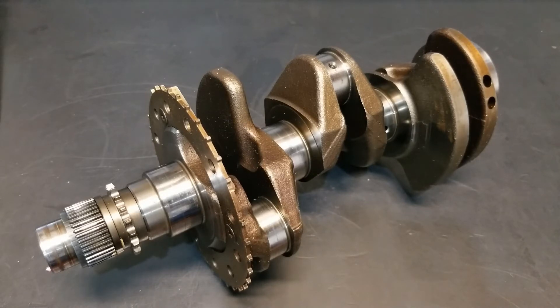This journal that we'll be measuring today is a main bearing journal on a crankshaft from a 2019 Mitsubishi Mirage 1.2L 3-cylinder engine. In order to find journal taper, out of round, minimum wear, and maximum wear, we need to measure the journal in 8 different places. Because the measurements need to be accurate down to a ten-thousandth of an inch, an outside micrometer is our tool of choice.